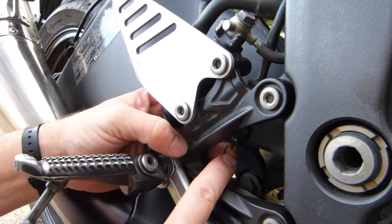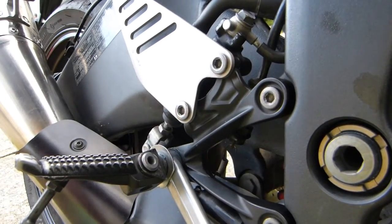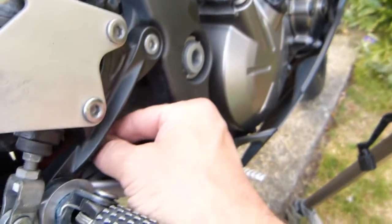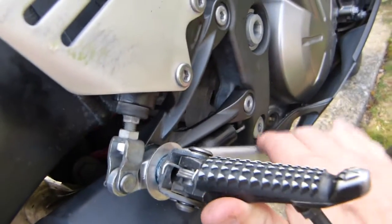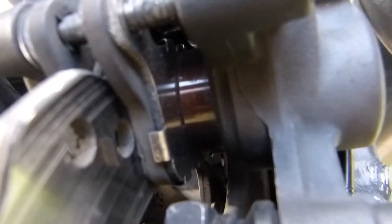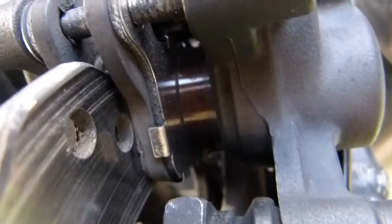Last item — check your brake light. You need to turn the key on. Let's check out the brake light. I'm going to pull the plunger on the switch — yeah, okay, that works. We know the wire works and the switch works. Let's see how this works with the pedal force. Oh yeah — flawless. And the brakes still work. You can see that the pedal is forcing the brake piston forward towards the wheel.